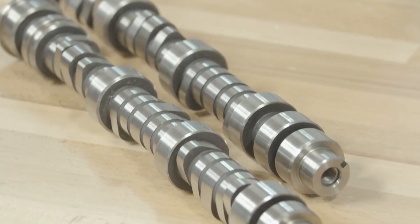The good part about our cylinder head program is we didn't focus only on power when the camshafts are released. We have seen gains throughout all the lift points on the cylinder heads. We first started by testing flow numbers within the range of the stock camshafts — testing between 100 lift to about 400 lift — and we have CFM gains across the whole board. So even if you run our heads with a stock camshaft, you will see gains. When the billet camshafts release, gains will continue to improve because at higher lift we're seeing even more airflow over stock — in some cases up to 25% more flow than stock.